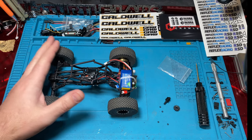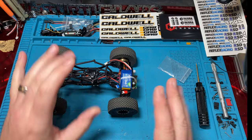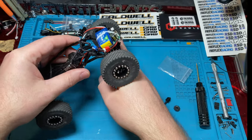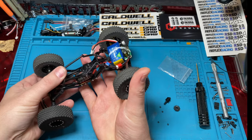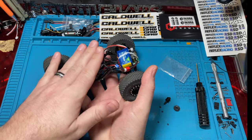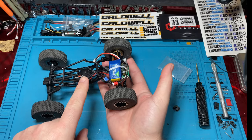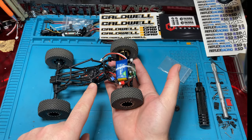Because we're gonna have lower torque in the rear and a little bit slower wheel speed, which means the front will grab, right? The front's gonna pull you up over rocks. It's gonna have a better, easier time to pull, and it's also gonna suck the rig down, right? So it's gonna help keep your chassis and body lower, because the front is gonna pull. When I pull, you can see pulling it causes it to suck down, right?